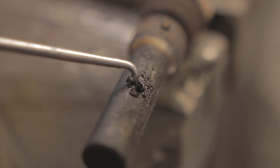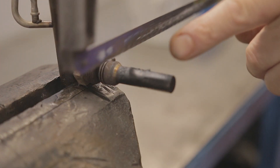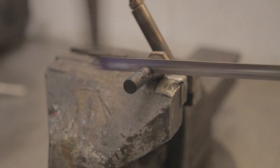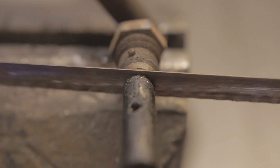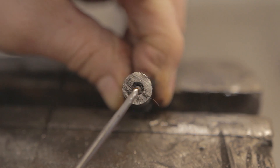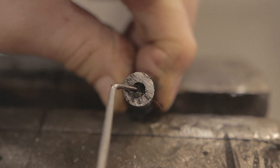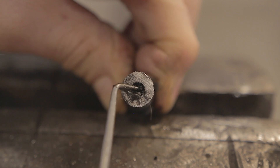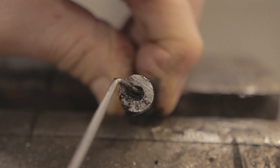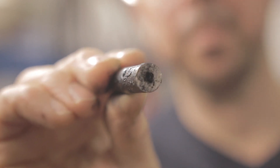It's just absolutely full of crap and the fuel can't get out. I'm now going to chop this open just to see how bad it is. Yeah, this is absolutely full of carbon in here, which is just blocking it all up — and it's actually crispy. You'd have to get a drill bit in there to try and dig it out. The whole length of this nozzle is going to get blocked up with carbon.